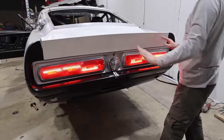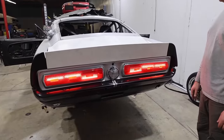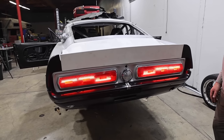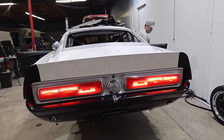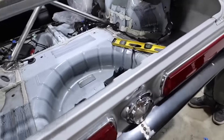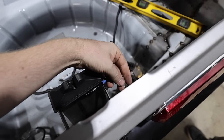For those of you who don't know, a diffuser — the idea is we just put something white in front of it, could be a piece of paper, and it'll just diffuse that LED and make the light beam spread a lot more. Okay, let's work on the hood and the trunk. The trunk should work just by closing it. We can test the trunk pop too. Trunk is closed. Double tap this — it made a sound but it made no pop. Okay, it doesn't think the trunk is closed. That's probably the problem. Let's fix the trunk and the hood. Well, that was a dumb problem — I didn't plug in the latch, and I also welded a small plate in front of it. So I'm going to bust this plate off, plug it in, and we'll give it another test run.